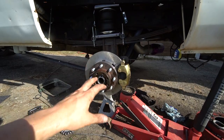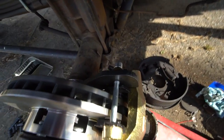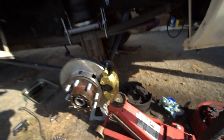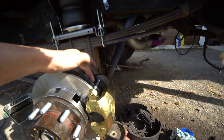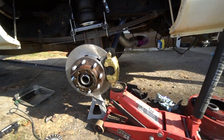because if you don't put that in, it could bounce back and forth and not be in the specific spot. When you weld that bracket, you need to make sure that your bracket is, I believe it's 3/4 of an inch from your rotor. And I measured that on the other side. It was a perfect view of what it's going to look like.